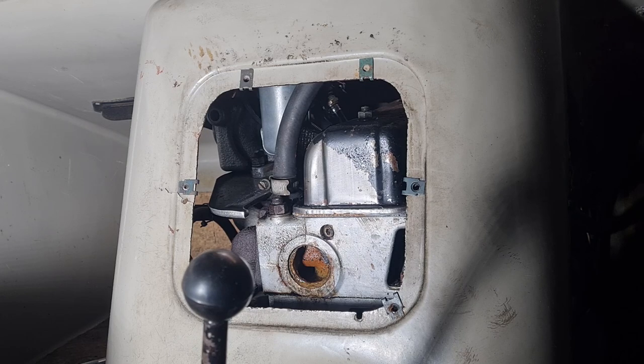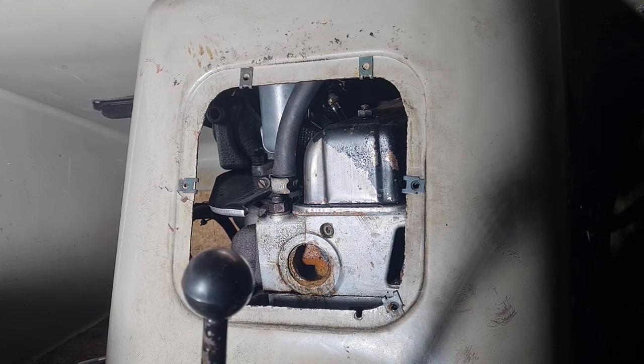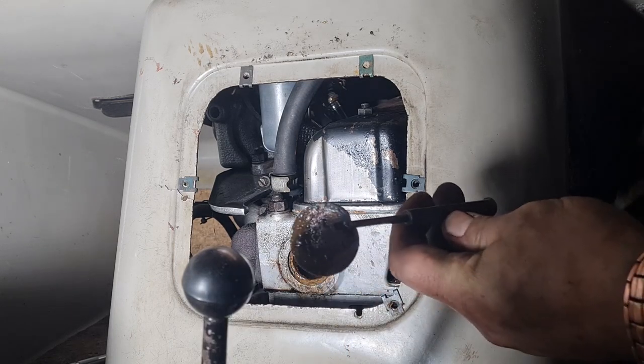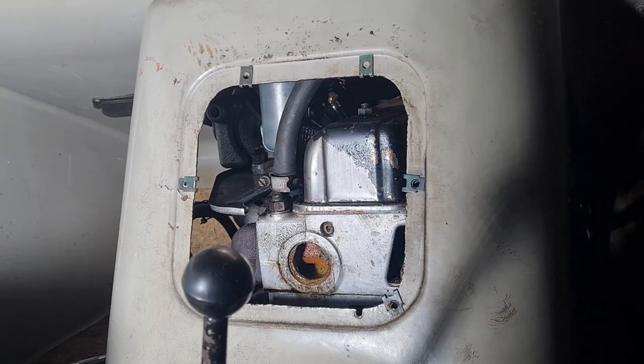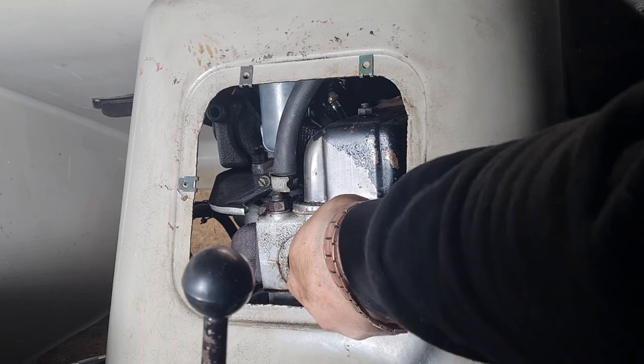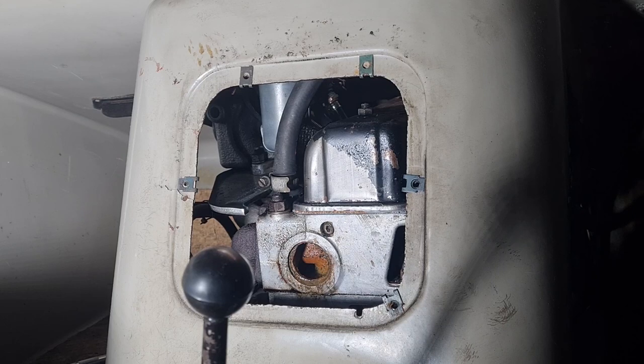With the rad flushed out and actually really clean inside - I was quite surprised there was only a bit of gunk - I've got this core plug out of the back of the engine. You can see it was a bit rusty, and in here is quite gunked up, which is probably why it was leaking. So I'm going to get a scraper in there, scrape all that recess out so it's nice and clean, get a wire brush on a drill as well, so that when the new one goes in it's got a nice flat surface to seal onto. I'll also put a bit of RTV around it before I put the new one in. Before that, I'm going to get the hose pipe in there and flush out any gunk that's in the head.